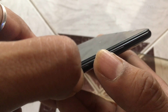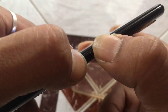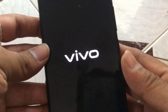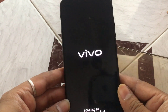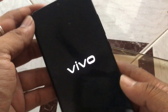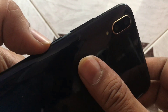I'm holding the power button and the volume button at the same time for 10 seconds. I think it's restarting — see, now it's restarting! So this is the shortcut you have if it is completely frozen. I'm forcibly restarting my Android device this way, because I cannot take off the battery.